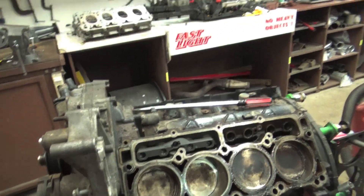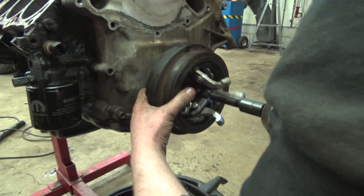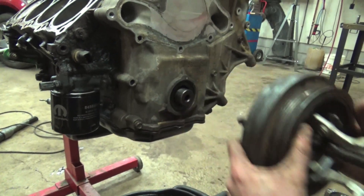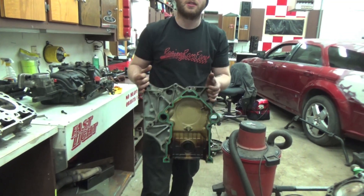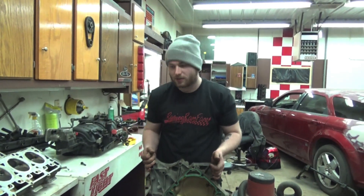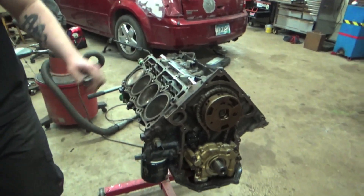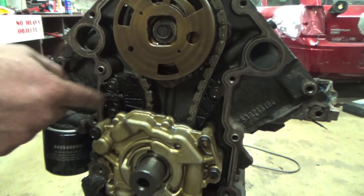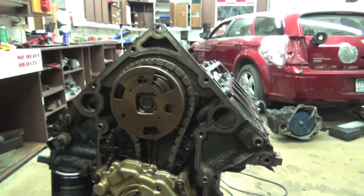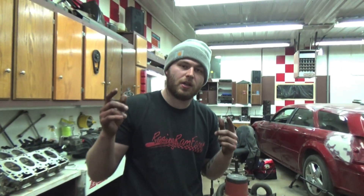Why are we peeking through the holes when we could just take it apart? Let's get that timing cover all the way off. That looks like a new timing cover gasket and that looks like a new oil pump. I'm thinking someone was in here before — someone was tampering with this little Hemi. You can't get the camshaft out without pulling the oil pan and oil pump off, so we're going to do it the right way and pull the oil pan off.